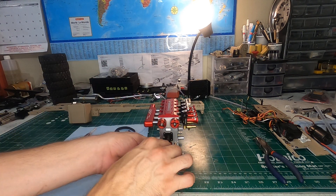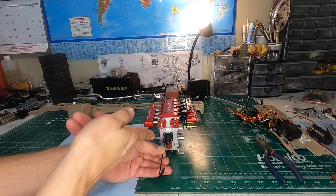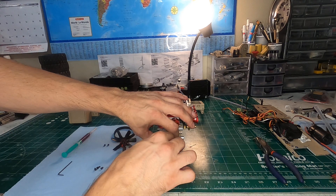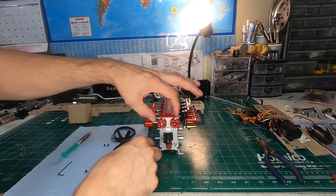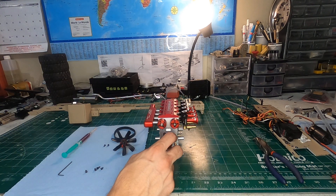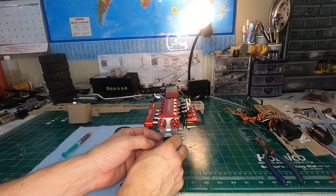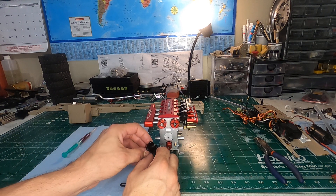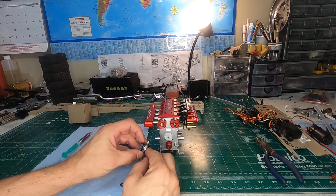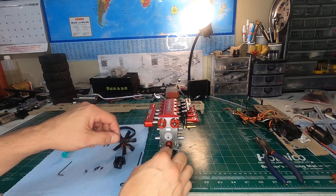This guy is almost ready to come out here. When I'm taking this water pump out I always leave this front plate on, because it's very easy for the little pulley inside here to be pulled out, and if you take that pulley out you can disturb the o-ring and the seal behind that pulley. Now I'm about to pull this out — there are my Teflon washers, or Teflon spacers. Leave that front cover in place.